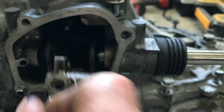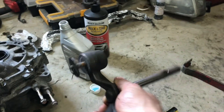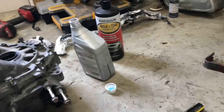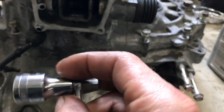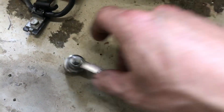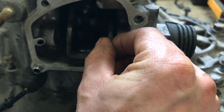Pop this piece out by pulling this shaft out — the shifter. Once that's disassembled, take this socket head cap screw out. Usually what I do, because it's a very tight clearance in there — you can use an Allen key. I use one of these, I believe it's a number eight, and I put it in a five-sixteenths closed end wrench. That way I can get underneath there and just loosen it a little bit. You don't have to take it all the way out. Once you loosen it up, it allows this part to rotate out. That all comes out.